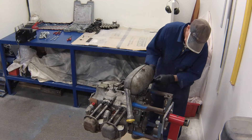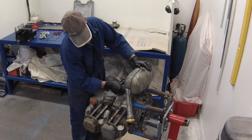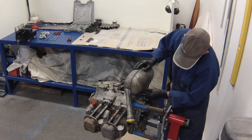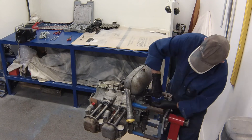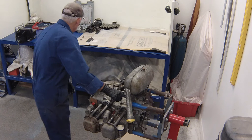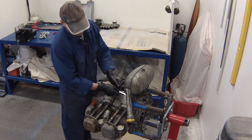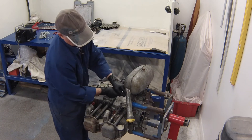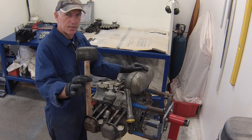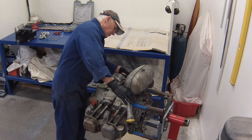Continental O200s use a semi-dry sump method where oil is scavenged from the crankcase and deposited into this sump bowl bolted underneath the engine. It's quite clever — in an aircraft environment where you can be upside down, on steep banks, and so on, the oil is contained in this small shaped area and has a better chance of being drawn into the pump in a constant flow. The steel sump being externally mounted also allows airflow over it, acting like a cooler. There's also a secondary stay along with the six bolts on either side of the sump that you need to remove before lifting it off. The sump can be mounted with the filler on either side of the engine — another clever feature.